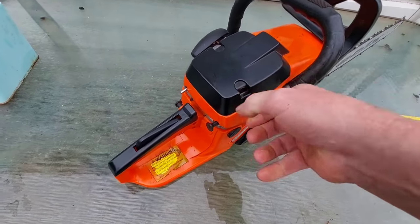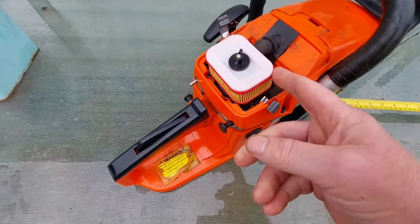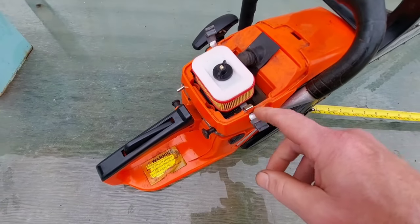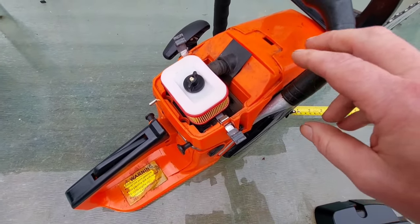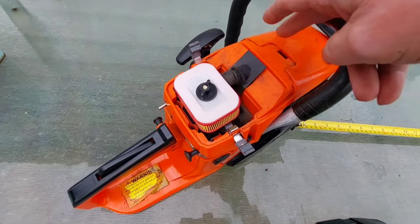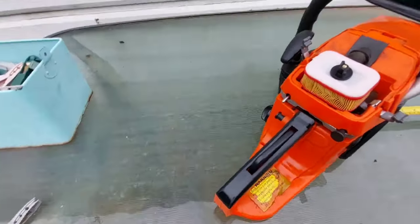It's got an aftermarket air filter, a paper one, so it's designed to last. That's up there, so it doesn't let crap and stuff into the motor. It's got four transfer chambers. There's two on both sides. You can tell by the vanes on top of the motor. It just runs better, has more compression. Try pull it over.